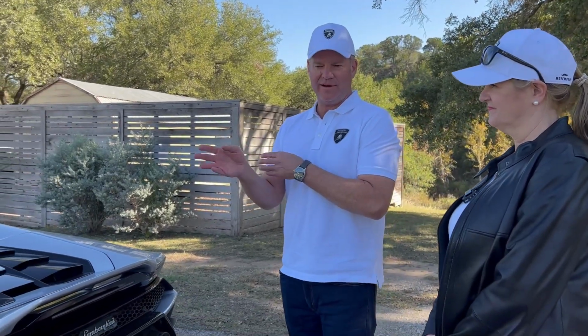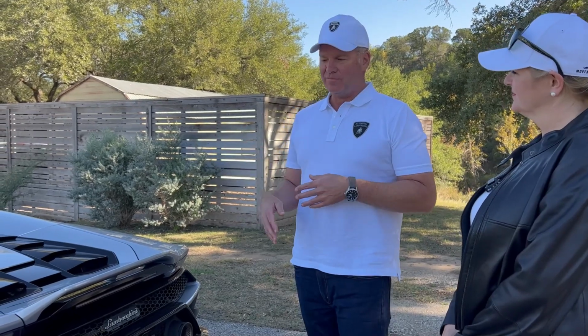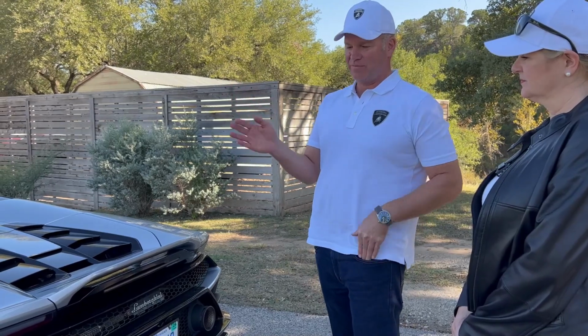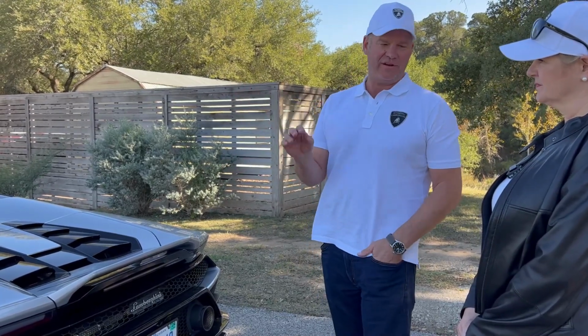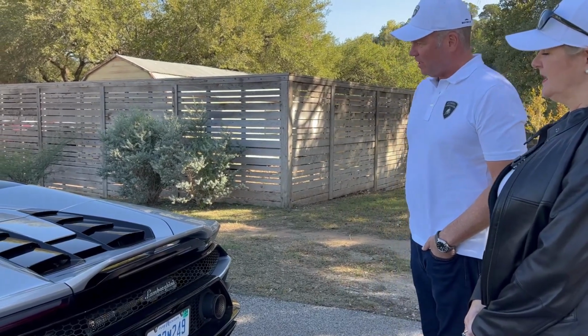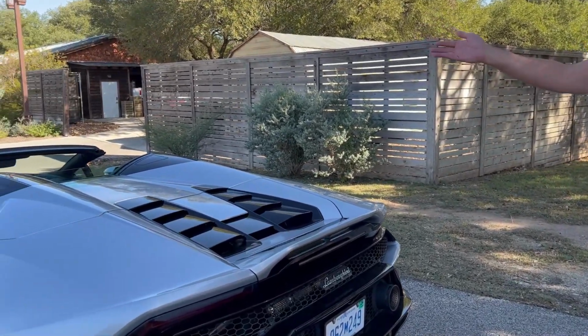It's all-wheel drive. Yep. And our newer cars are also coming out with all-wheel steering, which is really nice from a handling standpoint, because at lower speeds your back tires move counter to your front and give you a much tighter turning radius. At higher speeds they turn in concert with one another. So it's effortless turning at the higher speeds. Naturally, if you can imagine both your wheels turning at once, it takes very little effort to turn at high speeds. And under here is also our top.